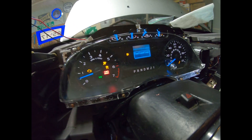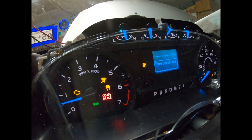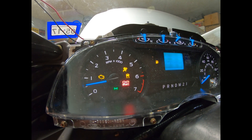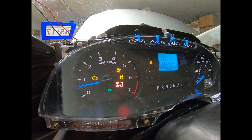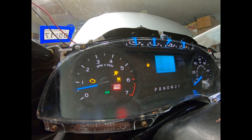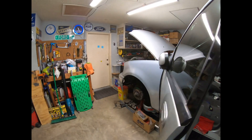We are starting to warm up a little bit on the temperature gauge. The idle has finally come down. I just got done reading codes — I've got the ambient temp sensor and a couple of EVAP codes, shouldn't be any major big deal. It's actually found its idle and it's happy there.